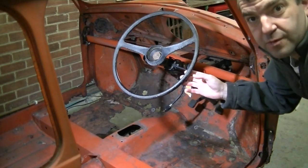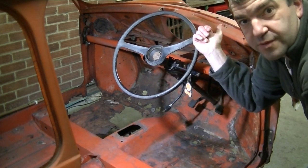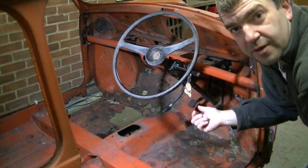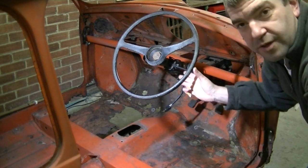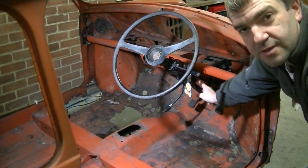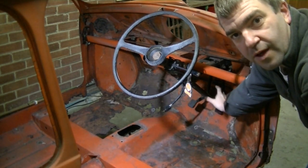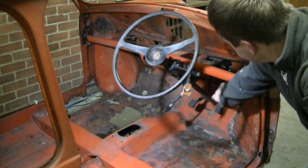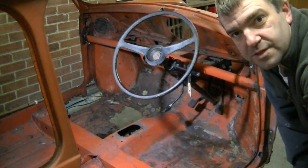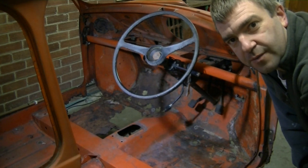Right, okay, so we've got the steering wheel. That's got to come off. It's just a nut, same as we used for the subframe for single bolt. And your hub nut for the discs, that's the same size. So yeah, we take the steering wheel off. We've got a shear bolt here, which actually has been sheared. So we're going to cut that one off or drill it out, either or. And then we've got a bolt at the bottom of the steering column, and then that should remove the column. We've got a few bolts to hold the pedal box in, and then we've got four bolts holding the steering rack in. So I'll bring you in and we'll have a look a bit closer at what we need to take off, and then we'll crack on.